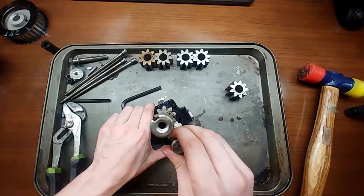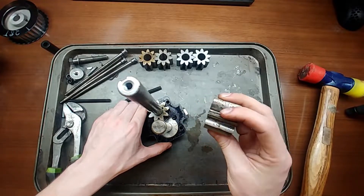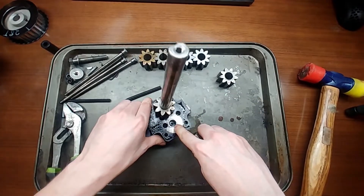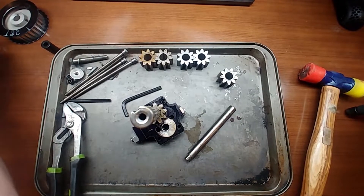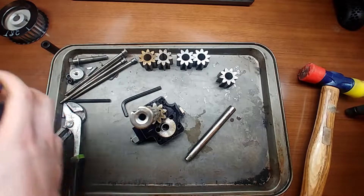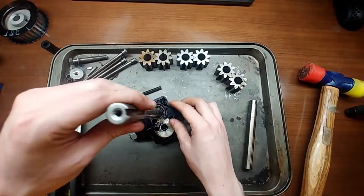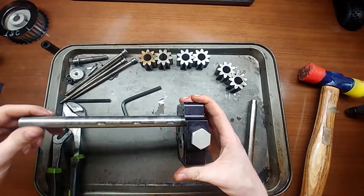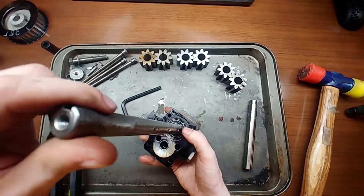Idler gear off on its own. The idler shaft is just kind of sitting down in there, since those gears can spin independently of it. There's no bearing on these — it just sits in a little machined surface, and there are oil-filled ports in there so if it does need to spin it can without seizing up. On the front side of the pump, there's also no bearing — it's just machined relatively tight so it can all spin freely.